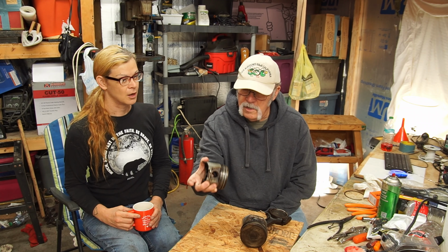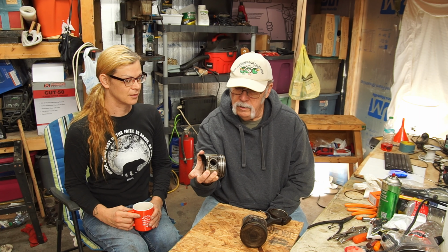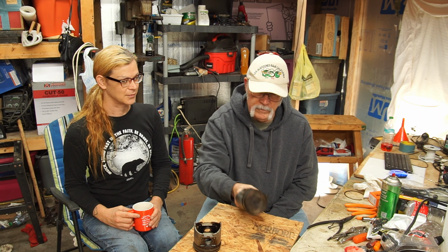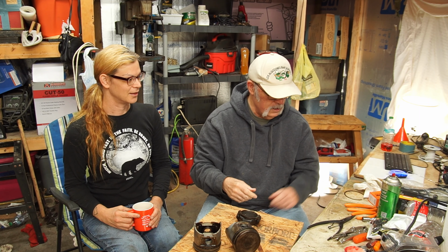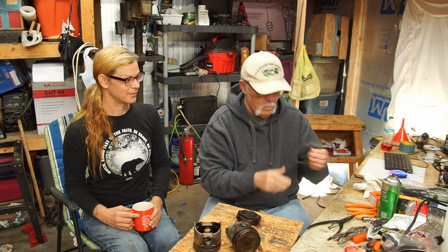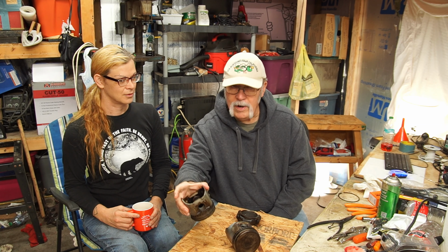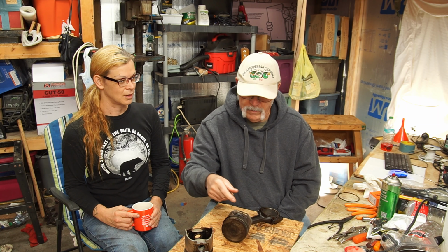Some old pistons. They have pretty good rings on. Kim says they're pretty good rings. I don't know, I guess they could be. We have these out of a slant six that are definitely bad rings because they're really loose in there. Here's the ring land, they're loose like this. And here's one of them out of that piston. So we're going to take these used rings and put them on this used piston because they're way better than the rings that are on.